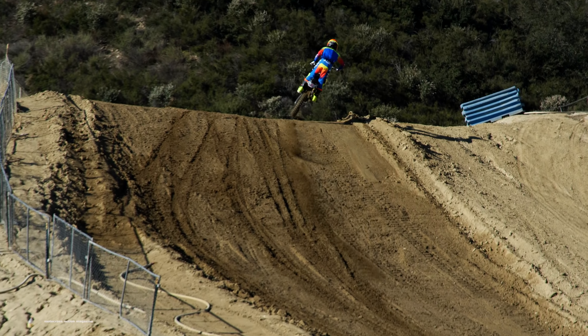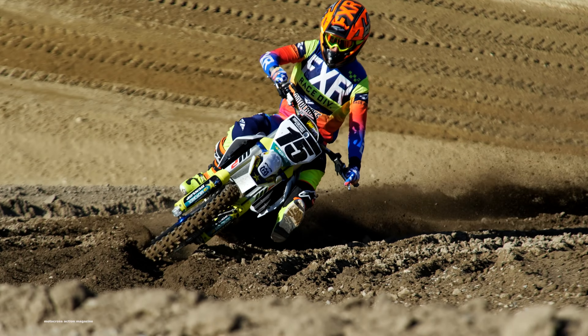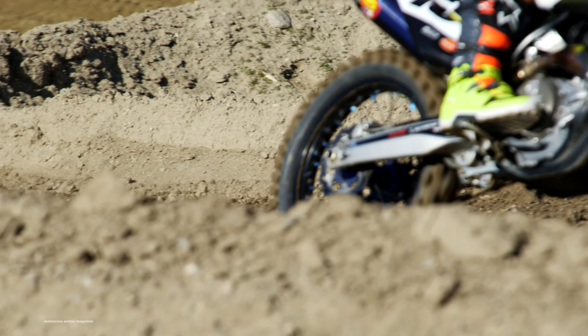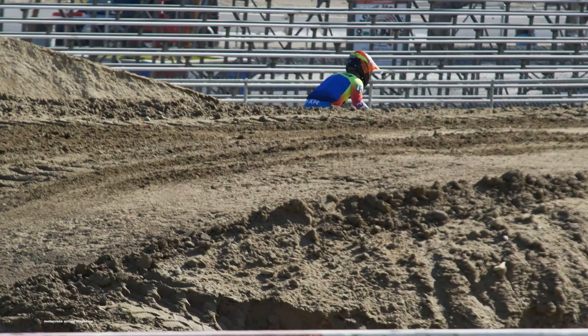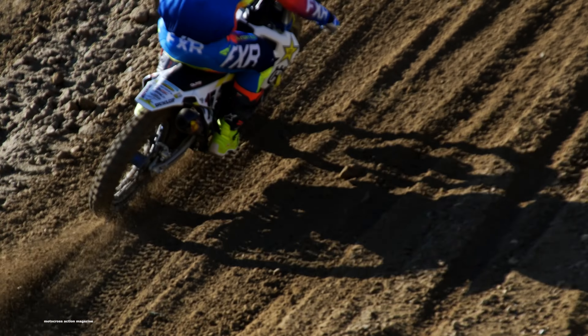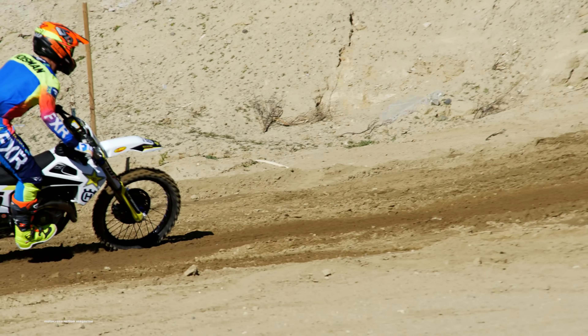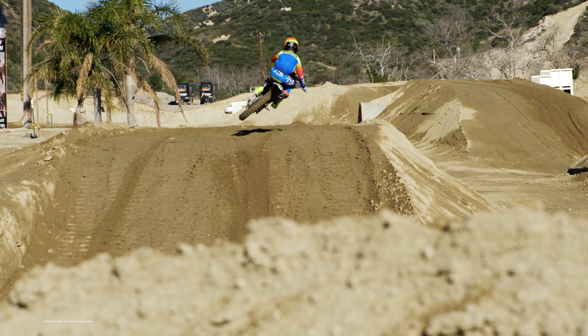So when we test the KTM next Wednesday, we're going to have pretty much the same feedback for that bike as far as suspension settings. What we did — the settings were very close. The great thing is we didn't have to make many adjustments. We went softer on the compression, but as far as air pressure, we left it at 10.9 bar — that's 0.4 bar stiffer than the initial stock setting for this bike due to the stiff front end. What makes this front end stiff is these triple clamps. Back in 2016 when the frame was different, you had this slap-down sensation which made it really harsh. I had that same sensation with this, and I really do not like it because it makes the fork feel like it just doesn't move. They started us 0.4 bar softer, and that was just way too soft for me — I was bombing out. Same with Josh.